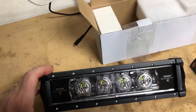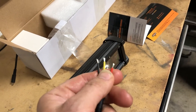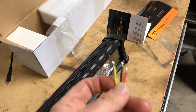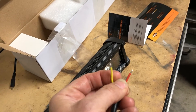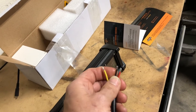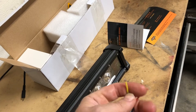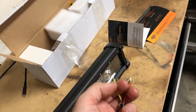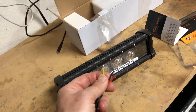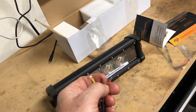One thing I wasn't sure about: you get three light-colored wires here. Usually the red is positive, black is negative, and yellow is ignition. But here what they've done is the red is your white beam, black is the ground as usual, and the yellow will be for the accent amber. As I mentioned, amber is not really for your fog light capabilities, although it might help. I'm not sure if you would want to split up the three wires or how that would work — you'd have to do a three-way switch.